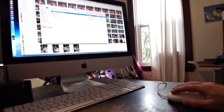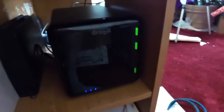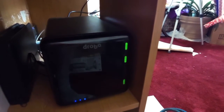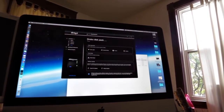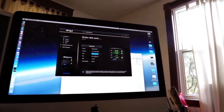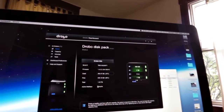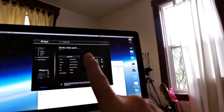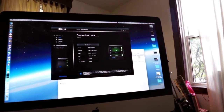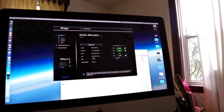Hopefully it will stay up, but I haven't seen any hint of disconnects like USB was showing. This is showing all perfect. I got this thing for ten dollars off eBay — the guy thought it was broken, probably because of USB disconnect issues which show up on newer versions of OS X. It hasn't disconnected once, and it is showing the active interface as FireWire. So that's success — FireWire resolves your USB 2.0 disconnect issues, assuming you have the USB/FireWire generation 2 Drobo, on the latest OS X with a 2010 iMac.